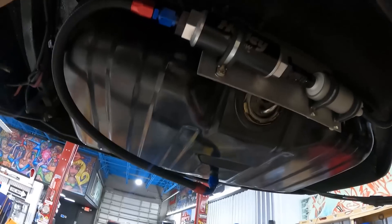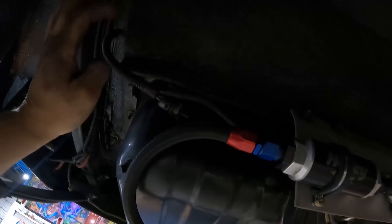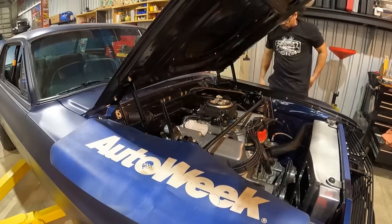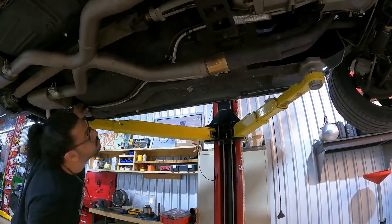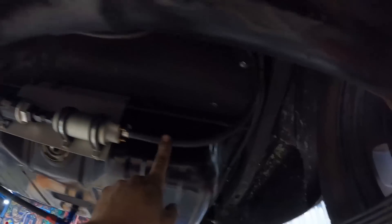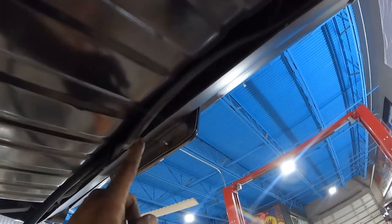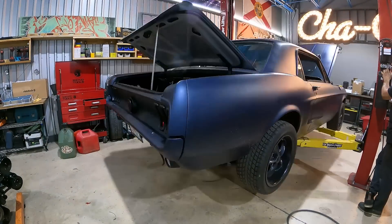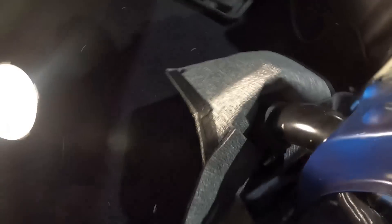She's coming along nicely. I've got my pre-filter set up; I still have to extend the wiring a bit. As for the plumbing, the feed goes into the pre-filter and into the pump. All routing is completed — a little heat shielding is needed near the exhaust. You can see the return right next to the feed, the post-pump filter, and the return line running all the way back to the tank. Now I need to get it up into the fill neck so we can dump fuel back into the tank without pulling the fuel tank.